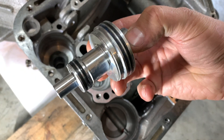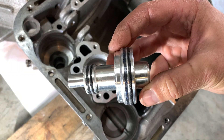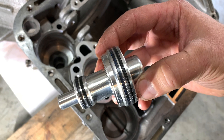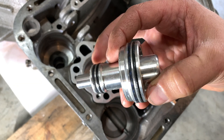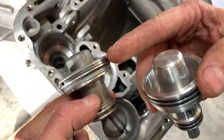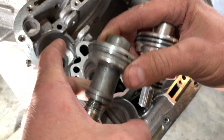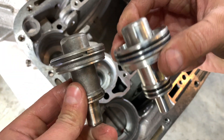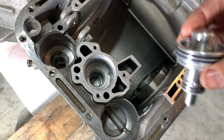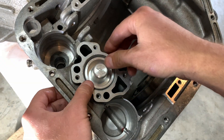It's your second gear accumulator. This one is from Cope Racing Transmissions and has double sealing rings top and bottom and a built-in blocker rod. There's your factory one — just a single top and bottom. You could make your own blocker rod out of a bolt, but this one's better. It is billet and it will seal a lot better with those two rings.